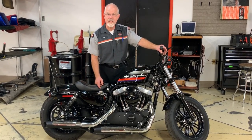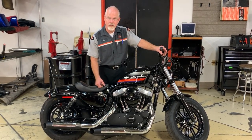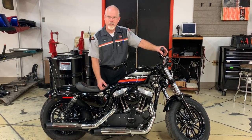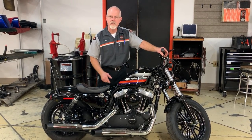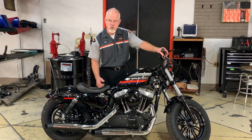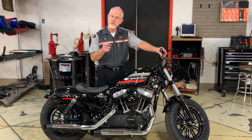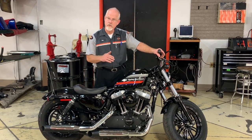Thank you so much for the email. I laughed a lot and I hope you did too, but we all learned that let's not put oil in a cold Harley-Davidson. You could even wait three minutes, fire up the motorcycle, and let it warm up to get the oil out before you check your oil on your dipstick. Also check your service manual, because some motorcycles are checked upright and some are on the jiffy stand.